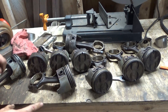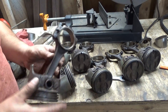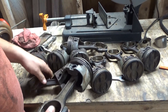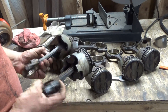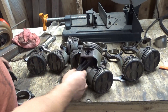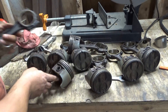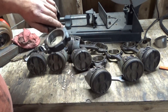Interesting — I just kind of confirmed that. This has been bugging me; it's why I haven't built the engine yet. I don't know what to do about that — maybe I'll leave them here until I think of something. These rods are supposed to interchange — I know this is later model stuff — but the main thing I just couldn't live with is the side part, because I know these things ride up against each other. They're supposed to have a clearance and be smooth, matched up like these older rods.